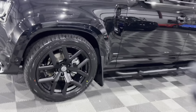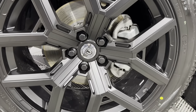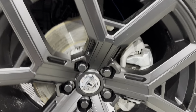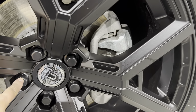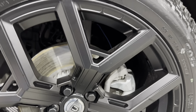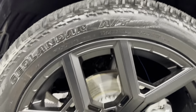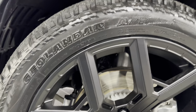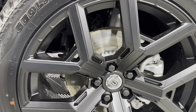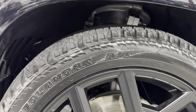First of all, let's start with the wheels. You've got the 22-inch satin black split five spokes with the urban centre caps. They've even taken care of all the details, such as wheel nut covers in satin black to match. Not to take care of the tyres would be silly. You want a tyre that's the correct rating. A lot of people put tyres on these that are not suitably speed rated — they put big off-road tyres, but they're not rated more than 99 miles an hour. They're actually dangerous to put on.